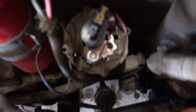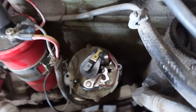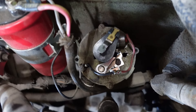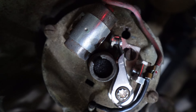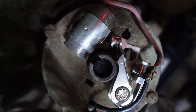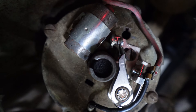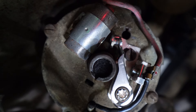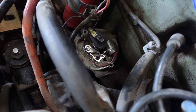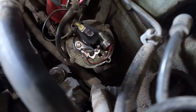I've got those points installed in there, it actually worked out really well. Just drilled that slotted hole, trimmed the daggy bits off — it was really close to that condenser but it all worked out. I'll just turn it over by hand and you can see it's opening and closing. Might see if we can crank it out and see if we can see any spark.